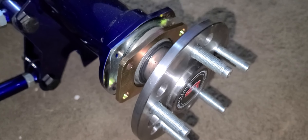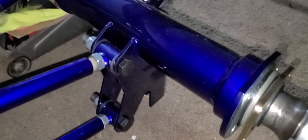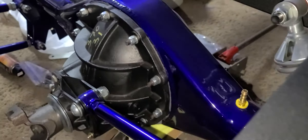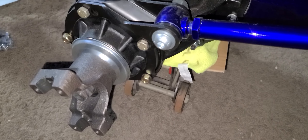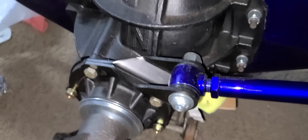It's not installed yet — we're going to do that this weekend. It's not completely installed, so here's a close-up of it. I took it down. It was just the universal one listed on Summit Racing, and then the third member I ordered was the 3.70 gear ratio and a 31 spline. Very, very nice third member. And then you have a couple different options for the U-joints for the different applications. The housing was a universal again.